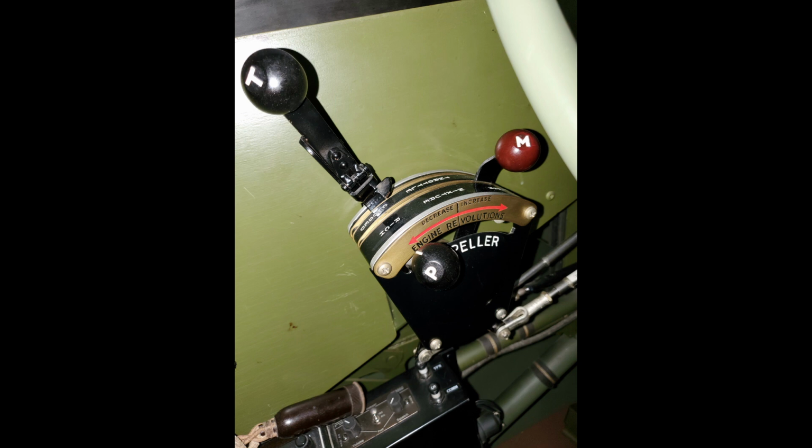But you think, well, what the heck are they doing that for? If you see that lever, while you're in cruise, of course, the throttle's going to be up here, the mixture might be around in this area. As you bring the throttle back to idle, that catch will grab the mixture and bring it automatically to full rich for you. So they did have a reason for it. But don't let some guy that doesn't know about that try to start your airplane. He'll be out there cranking and cranking. Of course, you're going to be thinking, oh, geez, what broke now?